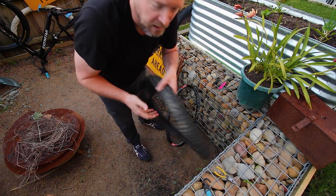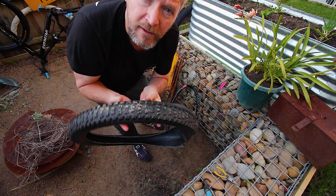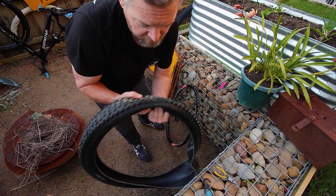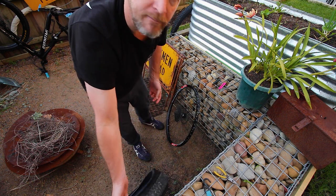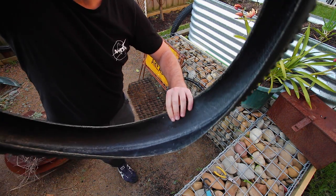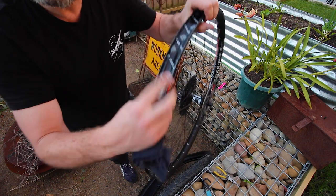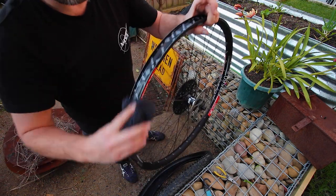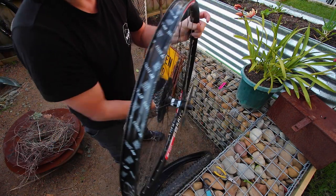One thing with this tire is that the sidewalls have pretty much gone after riding Medina and Derby, so that's why I'm replacing this one as well. Although the tread's still okay, may as well replace it for summer season and a bit of winter riding. The sealant has certainly dried up in this one, so it was well overdue for replacing or at least topping up. I do have a bit of a ding in this rim, so hopefully it'll seal - the other tire sealed okay, so hopefully it'll seal again this time.